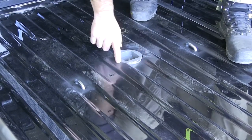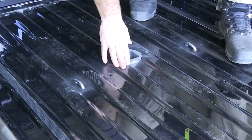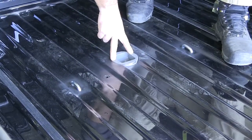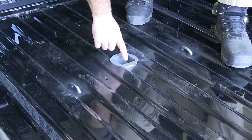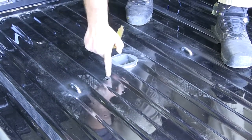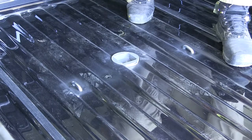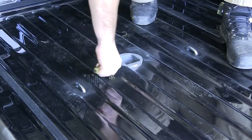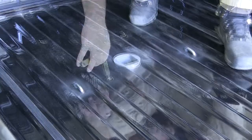You can see our safety chain U-bolts fit nicely in the lower corrugation, and our center section doesn't come up any higher than the raised corrugation — that gives us total bed access. What's nice about this hitch is instead of having the pin release lever on the side in the fender well, it's actually in the bed of the truck. It comes up with this little tool right here — you simply put it in and turn it to release.